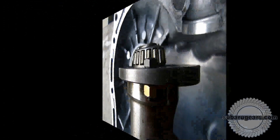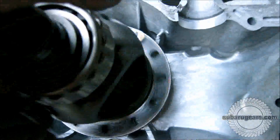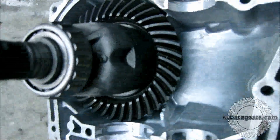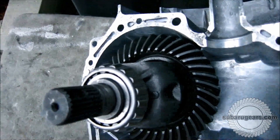This will ensure clearance. For Stage 2, I've clearanced just enough to let the bolt heads clear. We'll put the center in with its bolt in it and make sure that we get clearance all the way around without any interference. Now with the crown gear once again installed, although everything works, there's some clearancing to be done for the end of the crown wheel, so we'll mark those spots.